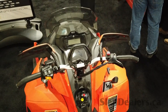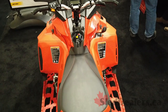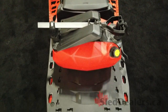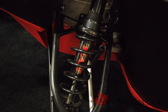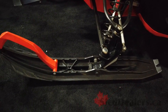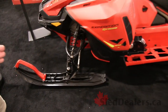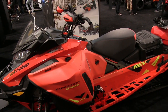Up front we have the RAS-3 front suspension. We had the telescopic front suspension before — now we're running the RAS-3, very similar geometry to the Summit and the MXZs. We run a DS-3 ski here. The DS-3 has a deep keel ski with a removable tip for different conditions — powder and hard pack. It's a really aggressive ski to help with cornering on this big track, as well as getting it up on its side and doing some carving in the meadows.